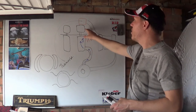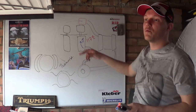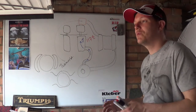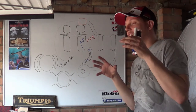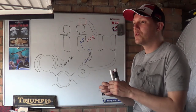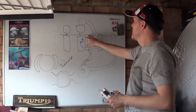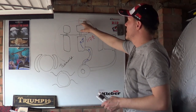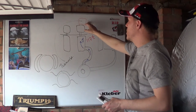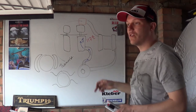And this is why your water system has to be pressurized, because 100 degree water boils unless you keep it pressurized. If you keep the water locked in as water, it doesn't have any room to expand into steam, so it just stays as water. And then basically it flows into your head, and as soon as this opens, it lets the dog see the rabbit, it lets the water into your radiator.